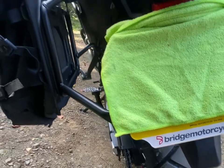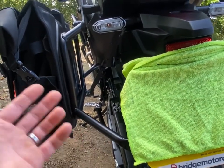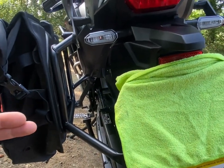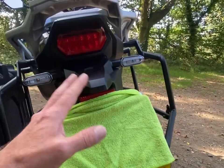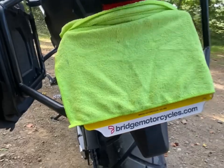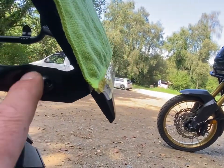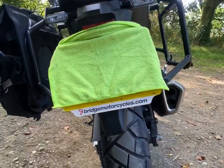But also if the bike was to go down, these aren't protective. They will protect it a little bit but the chances are, if the bike goes down this side, all this is going to move that way. And if this is bolted in, it's going to snap your plate hanger. So just do what I did and put the bracket in between the license plate and the plate hanger and you won't have any problems at all.